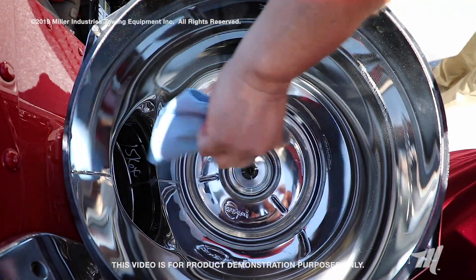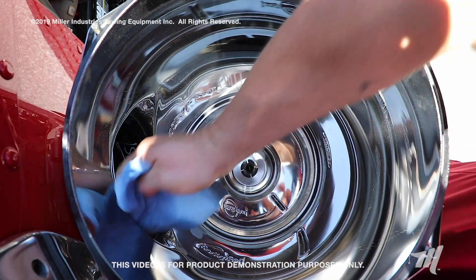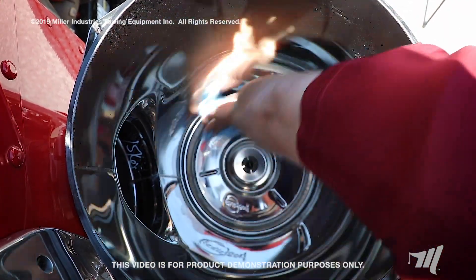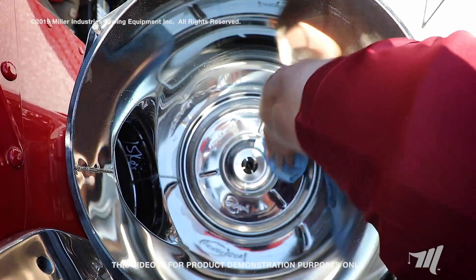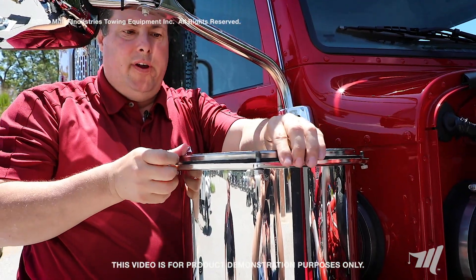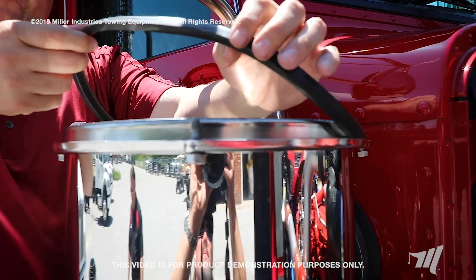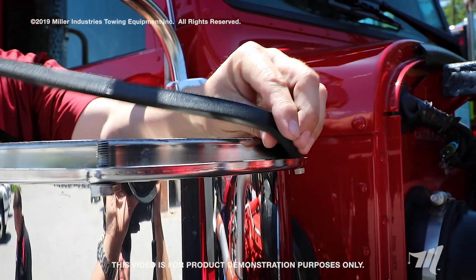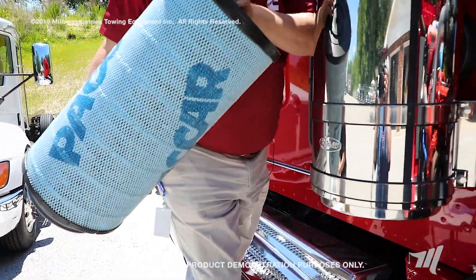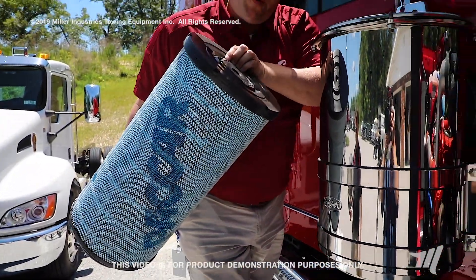Using a damp wet paper towel, wring out any excess water and wipe out any debris that may have come off the old filter. Clean out any dust or dirt debris within the filter housing. Before you install your new air filter, check your air filter housing gasket to make sure there are no rips or tears and that it's still serviceable. After inspecting your gasket, inspect your filter — make sure there are no rips, tears, or significant damage on your new filter before installing.